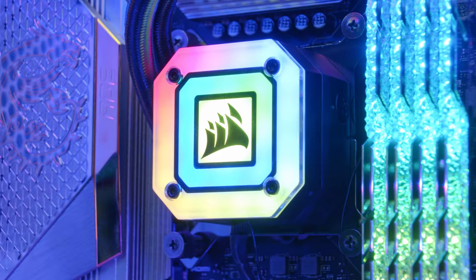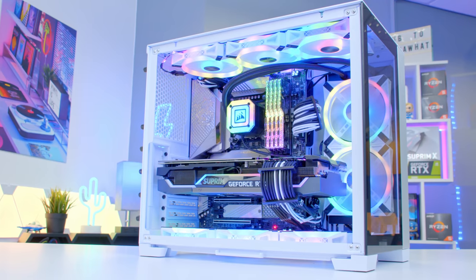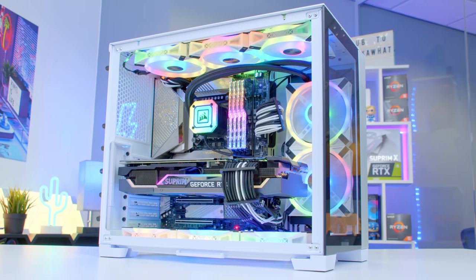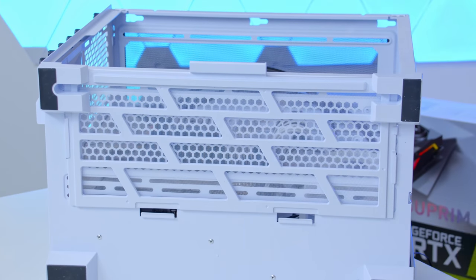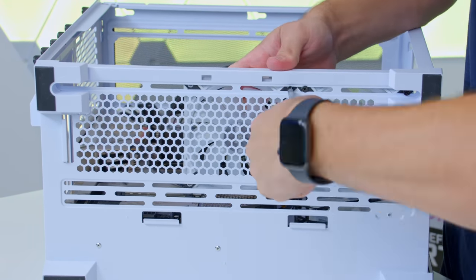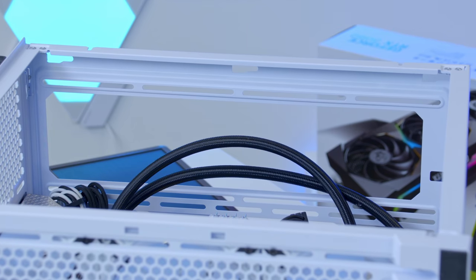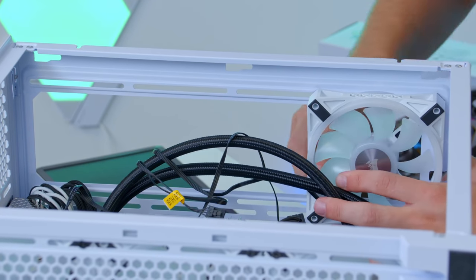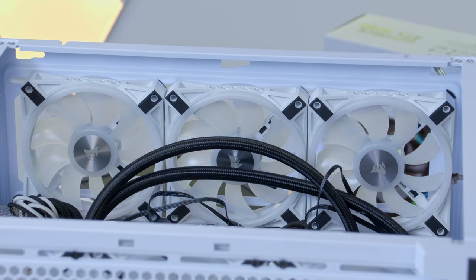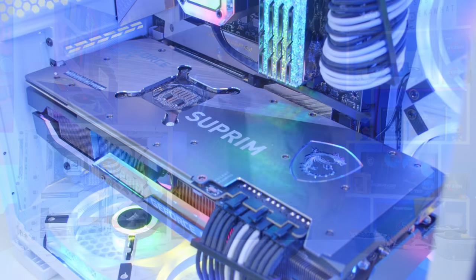That is really starting to come together. I was about to say we should move on to the GPU next, but actually we've got a few more fans to install — I'm thinking three 120s at the bottom and three 120s at the top. It does look a little bit better to have these all in exhaust mode, but your temperatures will be awful if you do that, so make sure you have intake at the bottom and exhaust at the top to give yourself really nice airflow through the case. These QL fans actually have a fourth RGB ring, which really differentiates them from the slightly more affordable LL series. I'll link those in the description below.